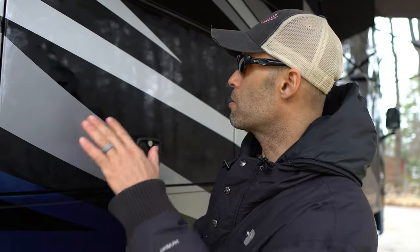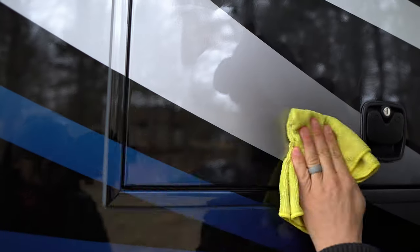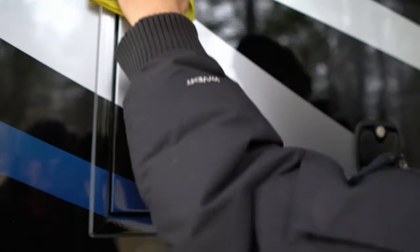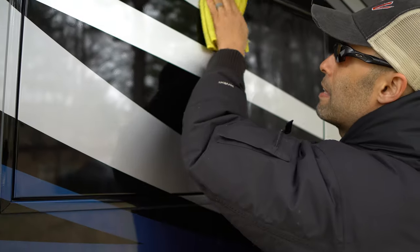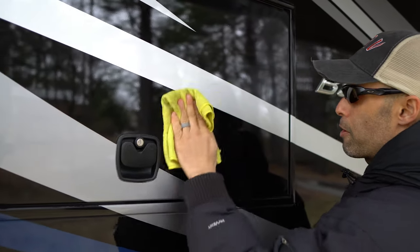Why I like this stuff — not only because of how long it lasts, but I think it has some kind of mild abrasives, and this is just my opinion. Especially on the caps, if there are water marks, I'll spray it down, wipe it with a little quick detailer spray, then use this on a small polishing pad and as I rub it, it takes the water marks right out. It's amazing how well this stuff works. Now this section behind me has started to haze up, so I'm going to take a clean microfiber towel and rub it out. It will powder up a bit, so you'll want to clean or swap out your microfiber towels periodically.